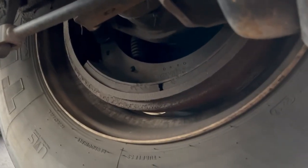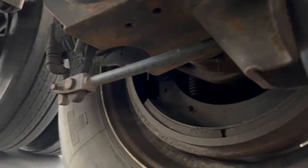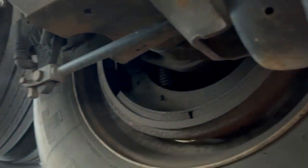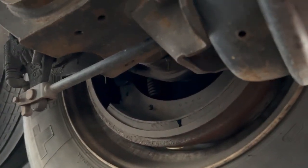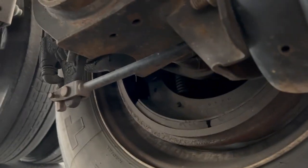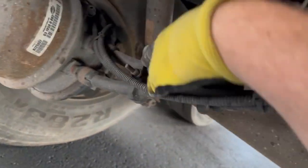Going further inside, we're going to look at the brakes — there is plenty of meat on the brakes as we can see. We're also looking at the wheel seals; this side might be easier to see. There's no oil coming from the wheel seals, which hold the wheel in at the bearings. I can feel the pins on the brakes — everything is in place. I go through and do that on all the brake chambers. I don't see anything chafing; the hoses are all in their sleeve protectors, so I'm happy with that.